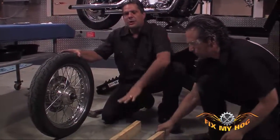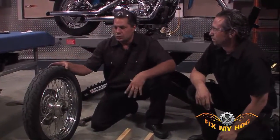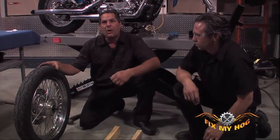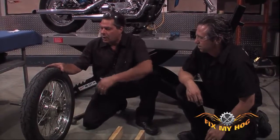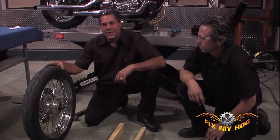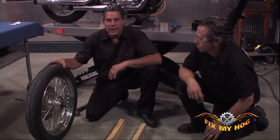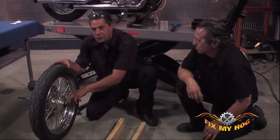Same thing applies with the wood. If you work up on a bench, you do lose some of the push power or the driving power of the swing of the hammer through deflection in the bench top. When you're on a hard concrete surface, every blow of the hammer goes directly to the driver tool.